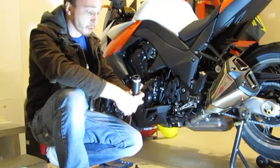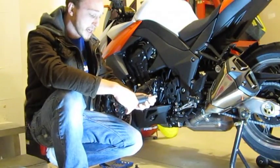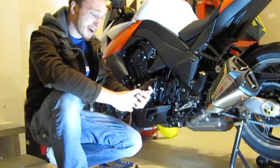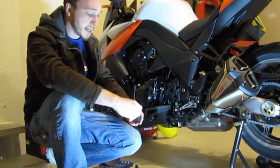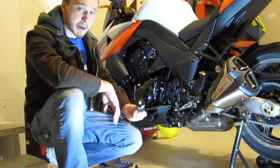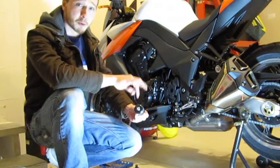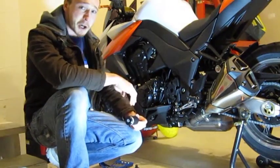They look like they're built really well. Real affordable frame sliders, and you can get them from OESaccessories.com. The sliders are Delrin. They're about 3 inches long, but I'd probably have to get an exact measurement on those. They come with a 12.9 grade bolt and the washers that you need to install them inside the slider. We're also going to recycle the washers that are on the bike right now to get them installed properly.